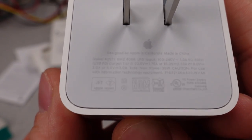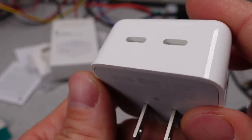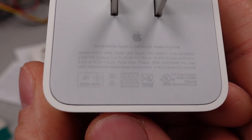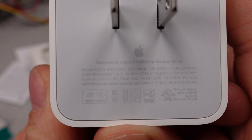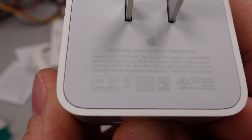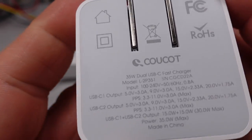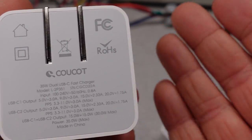Here's the power adapter. We can see the two USB-C ports located on the side of the device. It's a fairly small device and quite similar with the dual port setup versus other adapters. I looked at a Monoprice dual port 40-watt device, but this only offered 9 volts on each port, so it couldn't charge some tablets or any laptops. When we take a look at the Apple adapter, we see something important: the UL safety listing. This means the adapter doesn't necessarily operate at the highest level of performance, but it does mean that it is safe within a reasonable margin. The adapter also has the Department of Energy Level 6 mark, which means it uses very little power in the idle state and has high efficiency. The other power adapter is lacking the safety listing, unfortunately, which makes it an instant fail in my book. We may have to do a teardown to do some comparisons — let me know if you want to see this in the comments.